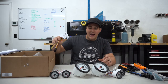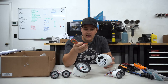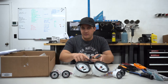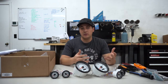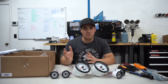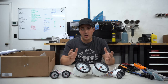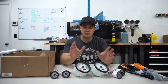Off the back of these gauge units, you'll have two larger harnesses that plug in here, so you run all of your sensor wires from all of your senders — your fuel flow and everything else — into these wires in the back, and these give all the data and power and ground to your smaller ones as well. This makes wiring in these gauges similar to a Dakota Digital gauge, except that a Dakota Digital has a separate computer that you mount somewhere under your dash. With these, the computers are contained within the gauges themselves, so you don't have to find a place to mount that computer. I really like that.